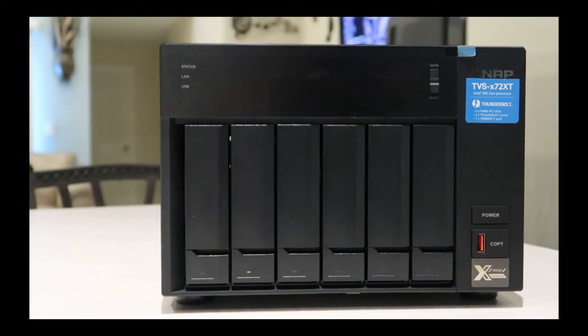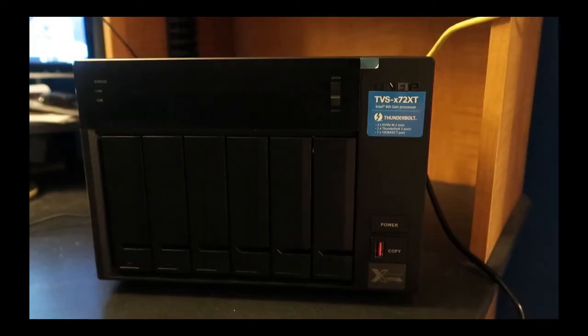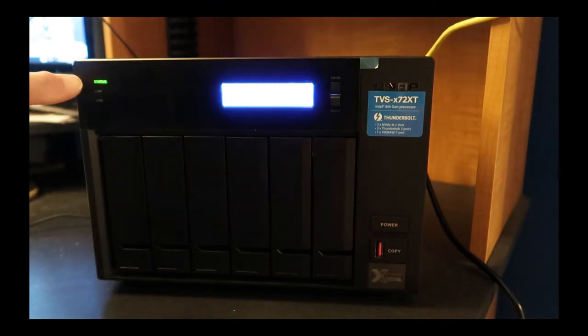Go take it where the main computer is, put it on the router, and provision this thing. Rip all the music into it, and once it's set up, I'll move it out to where the preamp processor is in the cabinet. Okay, it's hooked to the router with an Ethernet cord. We got AC power, gonna turn it on. Got a green status light, hardware initialization.